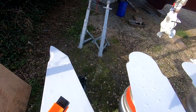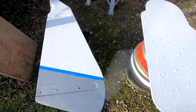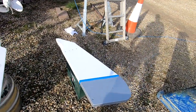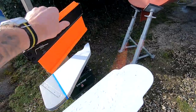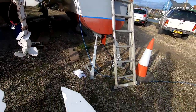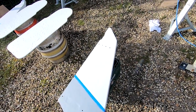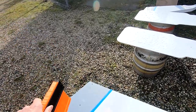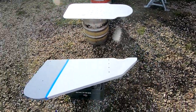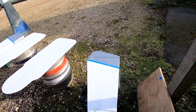What I'm going to do next is get the red on, because I've done this a good few hours ago so it's nice and dry. I'll get the hard red painting on the bottom ready to do the black. I also need to get the primer up here, which is exactly the same colour as the boat itself. I'm pretty sure epoxy primers fade and go off in the sun over time, so I need to make sure that's covered properly in the polyurethane stuff. Red paint when that's gone off, masking tape down and get the top half primed up. Yeah, not too bad at all.